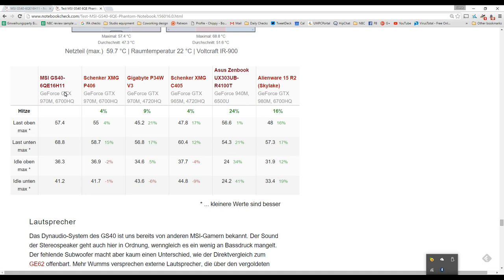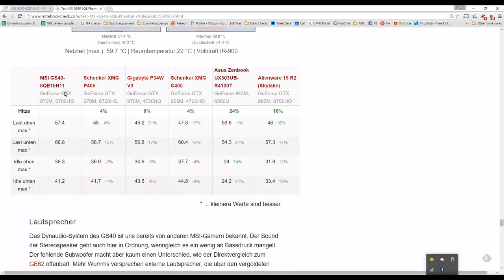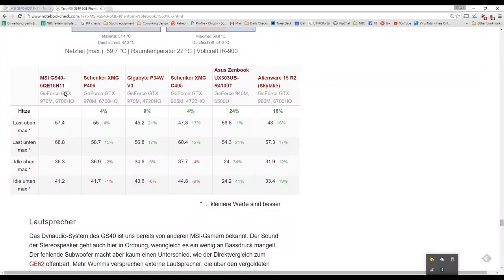Comparing against other devices in class — the Asus UX303, an ultrabook not designed for gaming, runs at 24°C normally and up to 56.6°C under load. Most devices in that class are cooler under load and certainly under idle. A 15W TDP CPU naturally generates less heat than a 45W TDP CPU, and you'll see that difference clearly in the idle temperatures.